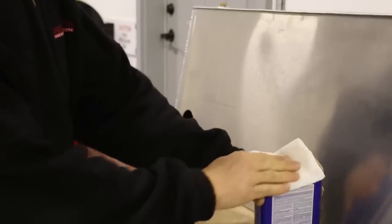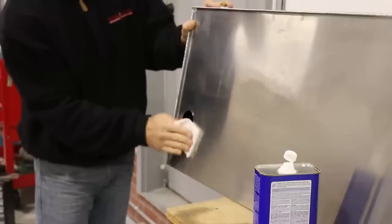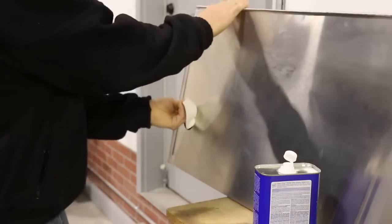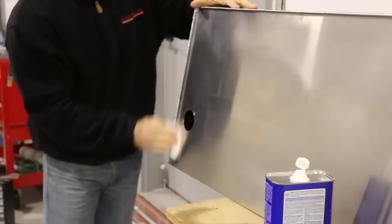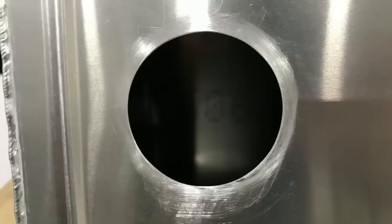If you use gasoline to flush your tank, go ahead and use some MEK or some other solvent and really wash around the opening. Because later on we're going to put some sealant on the fuel sender, and if there's any oil from the fuel, it will not stick to the tank. Make sure it is perfectly clean around the hole. What I'm doing here is scuffing up about a quarter of an inch around the perimeter of that hole — that's just to get the Pro Seal or sealant to stick better. Make sure you clean it again with some alcohol or other solvent when you're done.